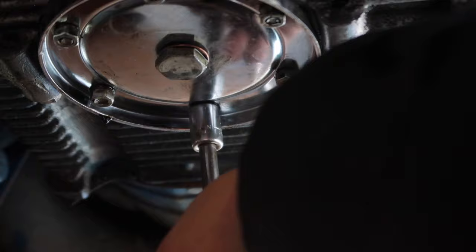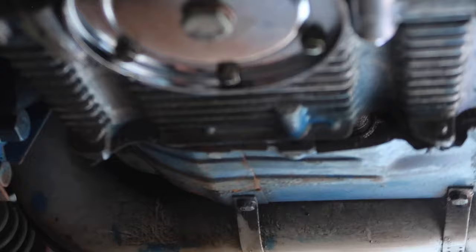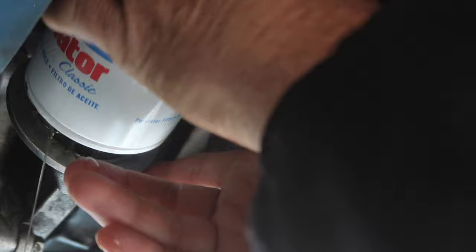You want to go around in a circle, slowly tightening it so it goes on evenly with even pressure. It's up and tight. Now I'll put the oil filter on — I primed it a little bit but it's sideways so you can only prime so much. You really only need to hand-tighten the filter. I'll get the oil off so it doesn't slip in my hands and tighten it up. Should be good — not going anywhere.